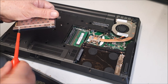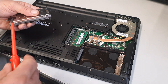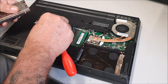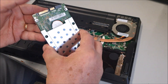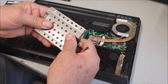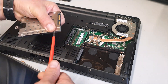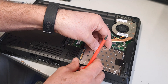Take it out of the cradle in the position that you find it — it makes life a lot easier for yourself. Turn it around and I'll show you what I'm going to do. Lift this off — so you've taken it off that way, so you know full well with the new drive — turn it upside down, put it back on the same way, line them up, and screw them back in. That's the drive upgrade done, slotting back in the same way.